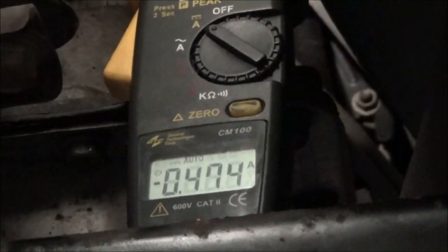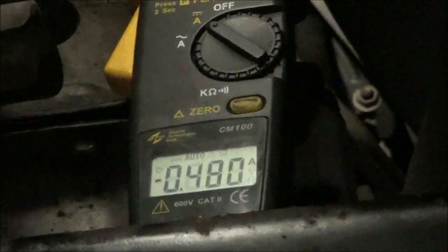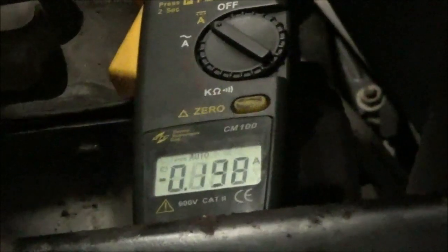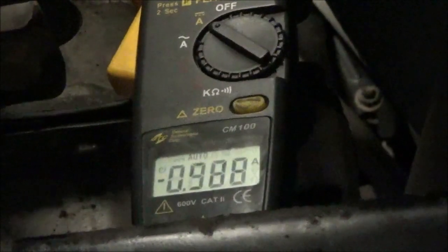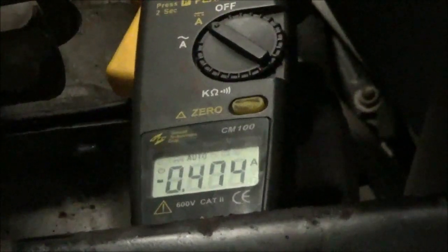I'm going to go with gear two and watch as it goes from two to three to four, to see if the solenoid is going to be on. I am in first gear, this is on shift solenoid A. It's hard to see both of these at the same time. Alright Billy, try to take it through the gears. Second gear is on, third gear is on. Go ahead: first, second, third, fourth — stop.